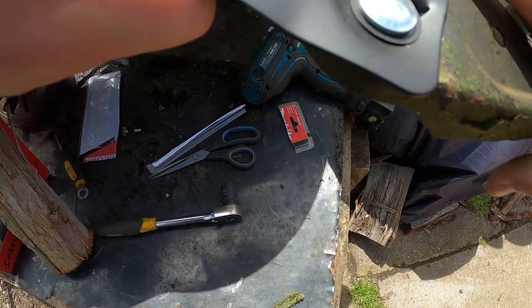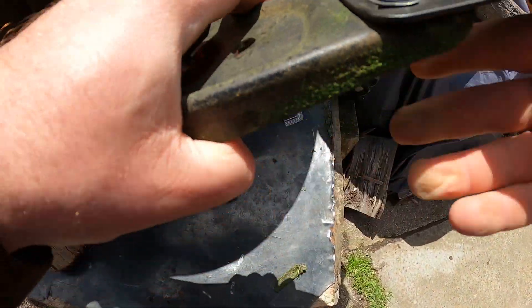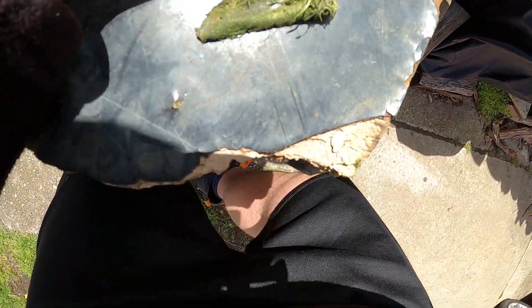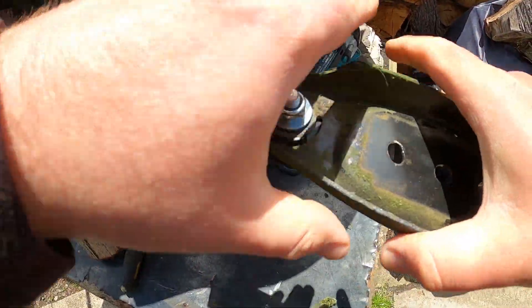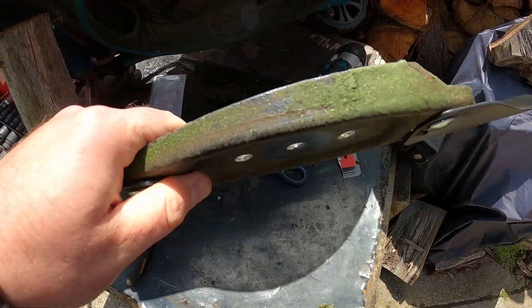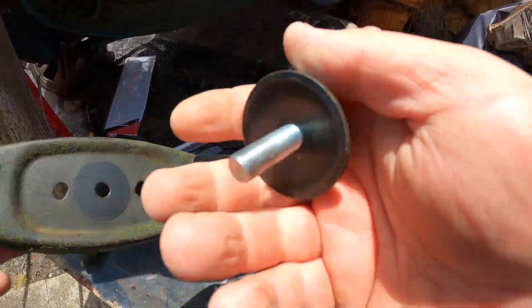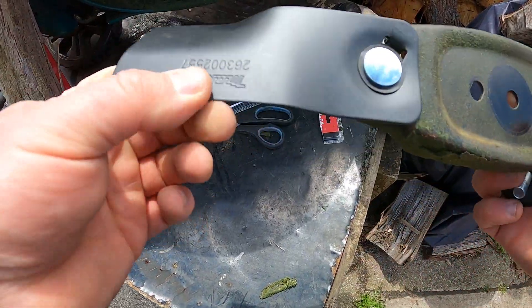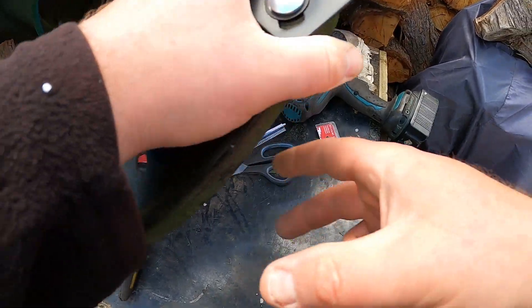Just make sure the blades can move, make sure they both can move, and make sure they're flush and properly seated with the tension washers. Make sure you do them up pretty tight too. If these come undone at all they'll work themselves out of the holes — because that's how them holes get worn out. Now to bolt the carrier back up, just get your bolt, put it on here and change them — they're genuine blades too.